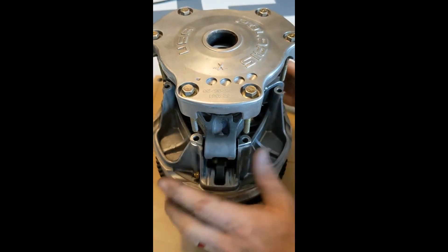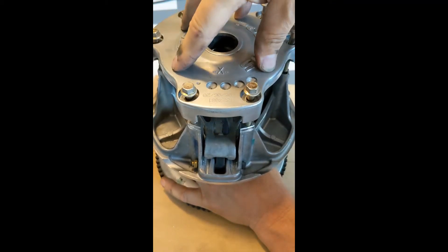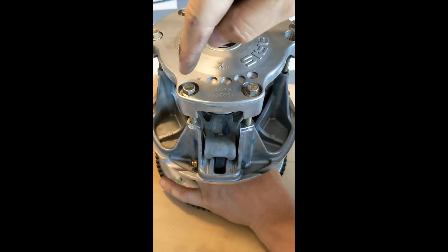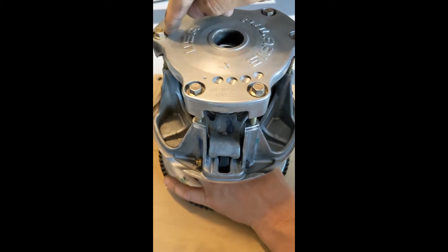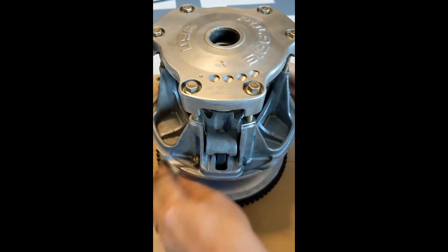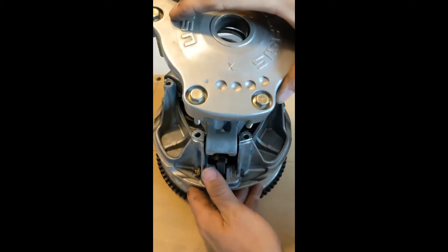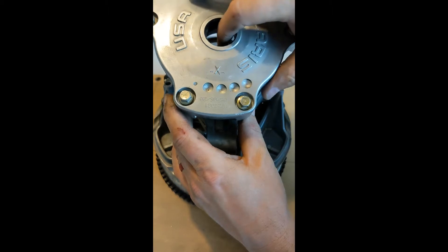All right, clutch is off the car. Got it inside — it is hot outside. So the clutch is partially disassembled. When your clutch cover is all screwed down and all the bolts are tight, what I do is back out completely one, two, three bolts, then slowly walk the cover loose a few turns each, and it'll eventually get to this point where the moving sheave will kind of fall away and the clutch cover is released. Notice this X right here — keep that in mind, we're going to come back to that.